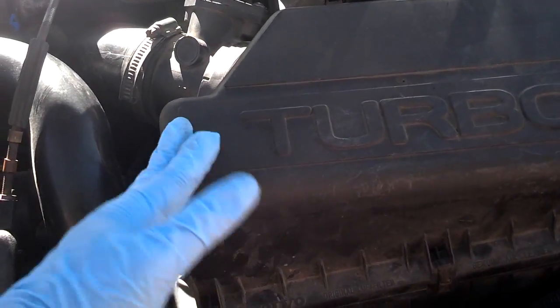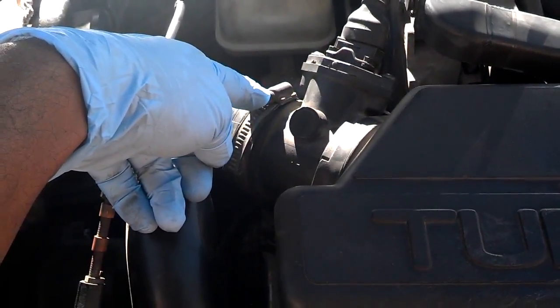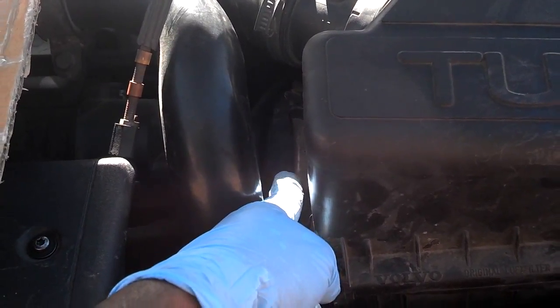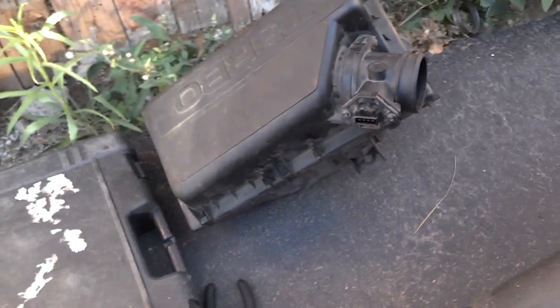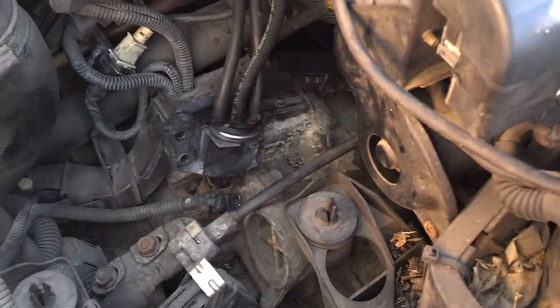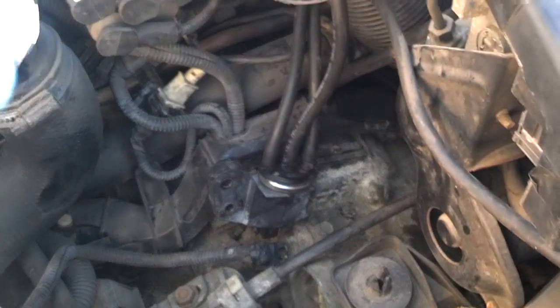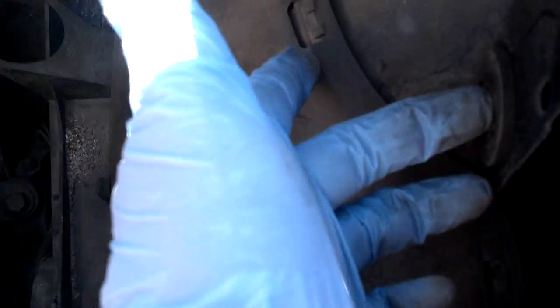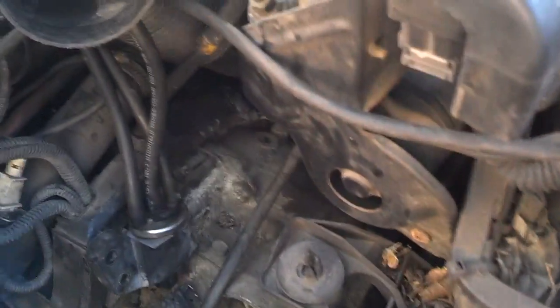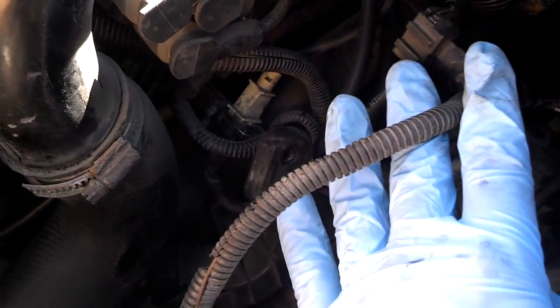I'm going to go ahead and remove the air box out of the way because I need that space to get to these bolts. So I'm going to unplug the mass airflow sensor, take this loose with a 7mm, unscrew the BCS from the side of the box, and lift the box out and out of the way. When you take the air box out, be careful not to let the back of it get hung up on things — sometimes the clip will try to clip on something else. Make sure you've got your coil wire loose from the back of the air box. The front of the air box is attached to clips, so once you get everything loose, you jerk up the front and it will come loose. The back has a pin that sticks through the fender mount. Once you get it up a little bit, take the two screws out of the BCS and unplug the electrical connector off of it so that the wires don't get damaged.